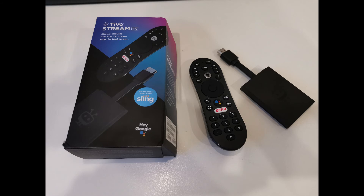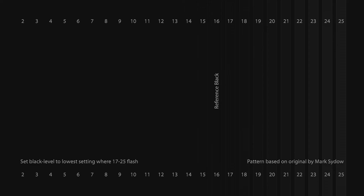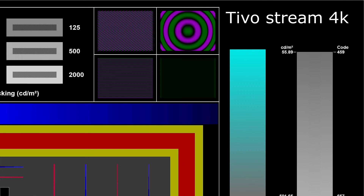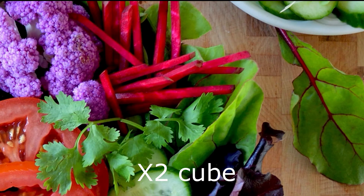Just recently, the new ATV10 firmware came to the device. I updated it, and for the purity of the experiment I did a reset and started the tests all over again — and the colors came back to normal, whiter-than-white is displayed, color clipping is also normal, and blacker-than-black is not displayed as before. Here is a fragment with ATV10 in SDR — everything is normal. There is however a problem with the display of the blue horizontal gradient in the HDR table, especially checked on the TV — most likely the reason is the output mode 444 12-bit. And the image enhancer is on in most cases — I was able to catch it working on almost every video.